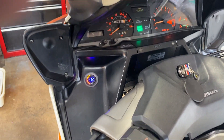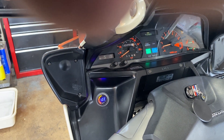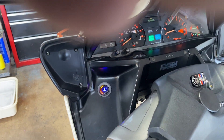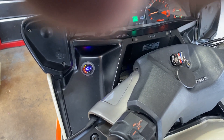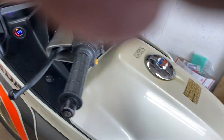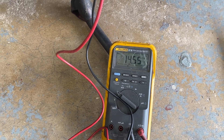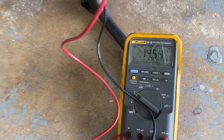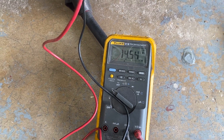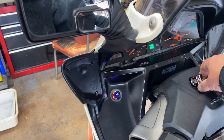Anyway, that's what I wanted to show on this video. There's high beam — battery voltage up here doesn't drop hardly at all, really. High beam off. Let's put the high beam on and see what the charge is looking at — 14.5. High beam off, still 14.5. The regulator is doing its job, as is the stator.